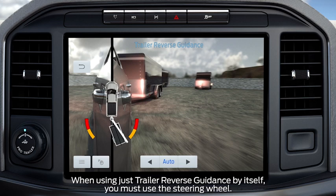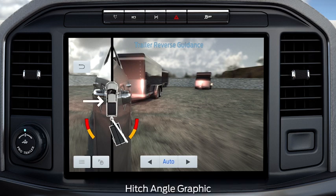The camera views can help you navigate your trailer into position. The hitch angle graphic display shows a top view representation of your truck and trailer with two different colored lines. A black line shows you where your trailer is in relation to your vehicle. For Trailer Backup Assist, the white line represents the amount the trailer will turn based on the knob input. For Trailer Reverse Guidance, the white line represents the amount the trailer will turn based on steering wheel position. This graphic can be seen in the normal rear view, bed camera, trailer auxiliary camera, and trailer reverse guidance camera views.